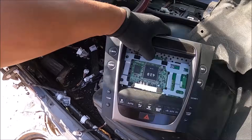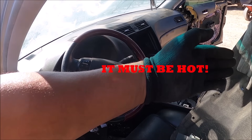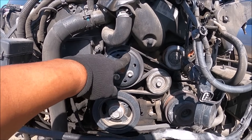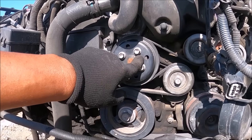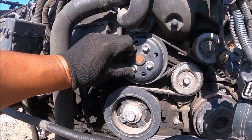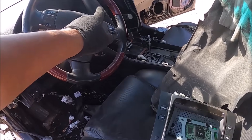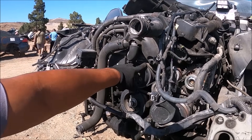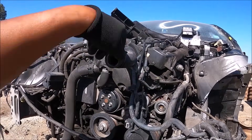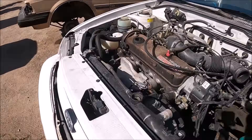Go to your heater, turn it up full blast so all the vents are open, and see if heat is coming out. There should be a lot of heat. If it's cool, that means the water pump is not pumping right — either the vanes are bad or the seal is bad. There's also a weep hole and a bearing seal inside; either one can go bad, start leaking, or the bearing can go bad, or the vanes could start disintegrating. Heat will come out regardless of whether the thermostat is open, so that's how you tell if the water pump is working.